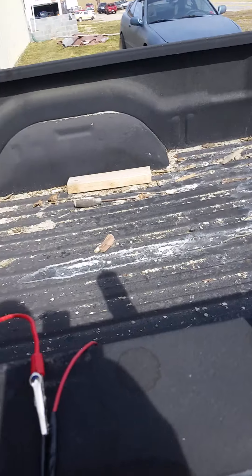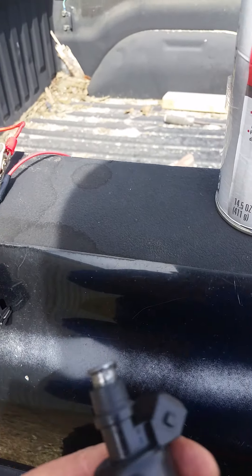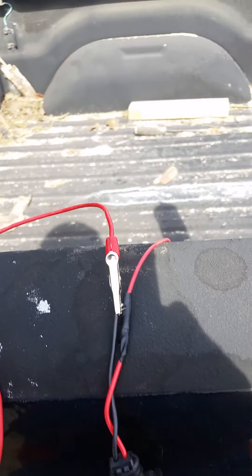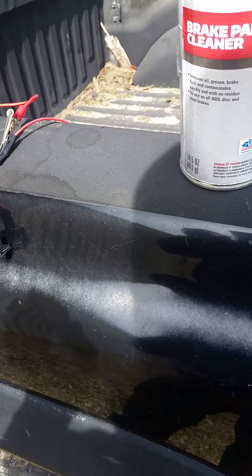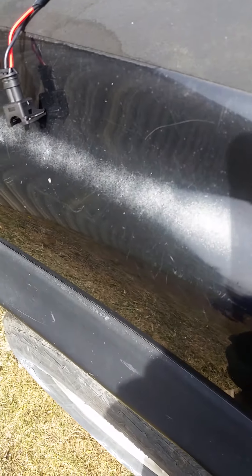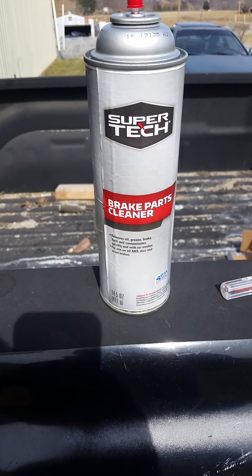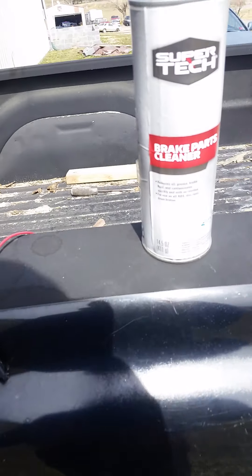That spray will let you know if it's working correctly. Another way to check is you can hear a click inside — it'll click every time you touch that wire. You don't want to overpower these; use as low a voltage as you can to make it work. It will spray a nice clean mist and it won't drip — it'll just spray. You can see a puddle where it sprays out, depending on what size injector you have.